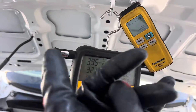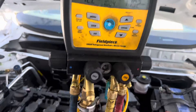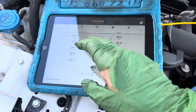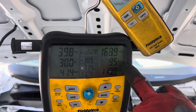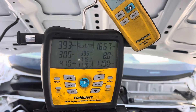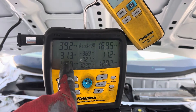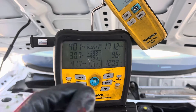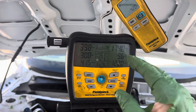We want 445 grams, so I'm stopping around 440. It's going to take a minute to stabilize. Our dash temperature is 56 degrees with 102 degrees going into the evaporator. Look at the subcooling — some vehicles have 30 subcooling, some have 40. Do not use a rule of thumb. You can see our superheat is not going down as a percentage proportional to the refrigerant added — it's starting to stabilize. But the subcooling as a percentage has increased greatly.